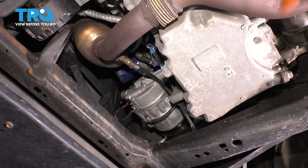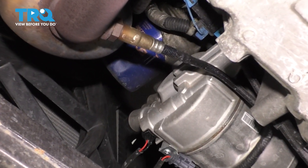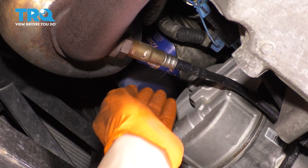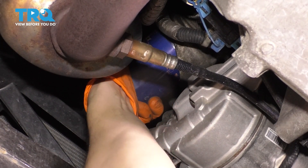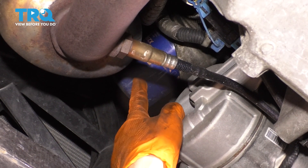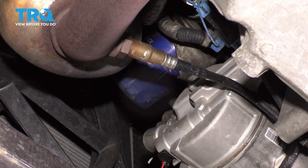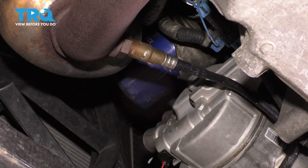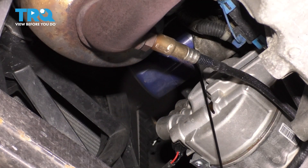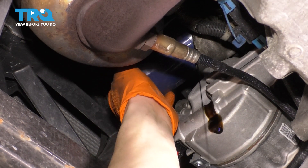Right here is the oil pan where we drained the oil. If you look in front of it, right up there next to the exhaust, between the exhaust and the AC compressor, you'll notice your oil filter. To remove it, sometimes you can grab it and spin it by hand. Other times you might need an oil filter wrench, which fits right on these cutouts. Have a collection bucket ready because it will leak oil as you unthread it.